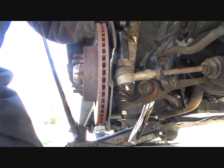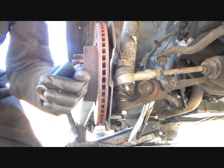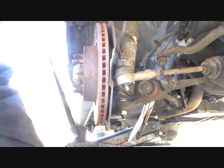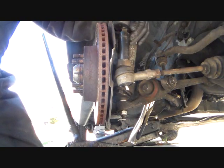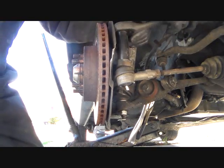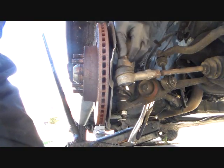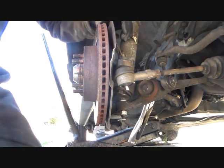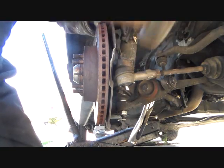18. Oh, by the way, these sockets, if you can see these or not, these are these good old cheapo Harbor Freight impact sockets, 1/2-inch drive sockets in metric, and these are the ones that I recommended to Robert to use instead of, he keeps trying to use those 3/8 adapters, and that just ain't gonna work, man, because a 3/8 adapter just won't take that kind of torque when you got a rusted assembly.